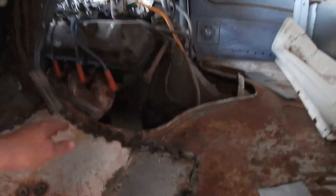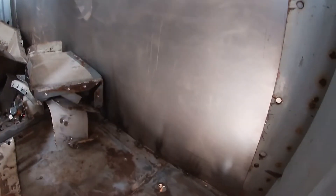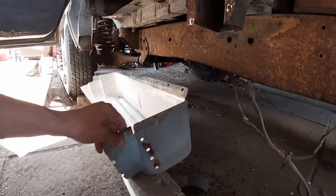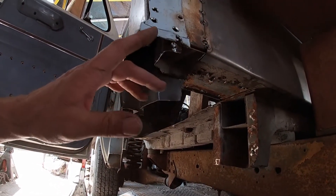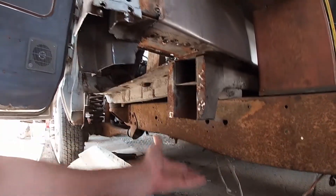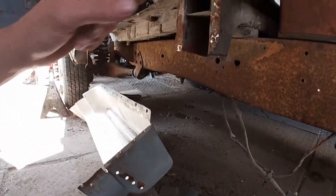All this is fresh metal. It still looks a little cruddy with the wire wheel but it's coming along good. I haven't decided if I'm going to replace this entire corner piece or not. You can see there are a lot of extra holes in that one compared to this one. I'm going to reconstruct the rest of the sill as we get it put back on. The easiest way at this point is to lift it straight up into here — this is where I cut back to where all the rust is gone. We'll tack it in along there and then start reconstructing.